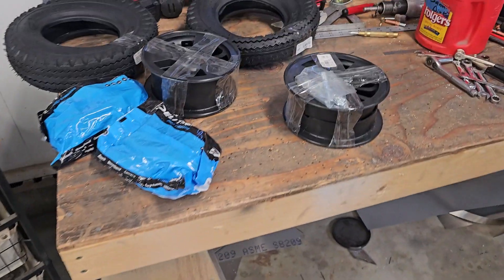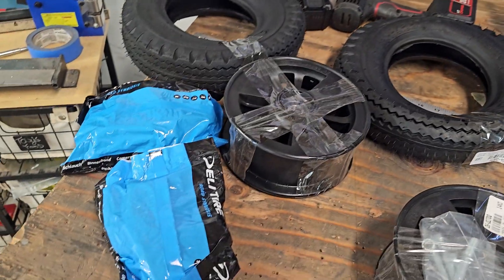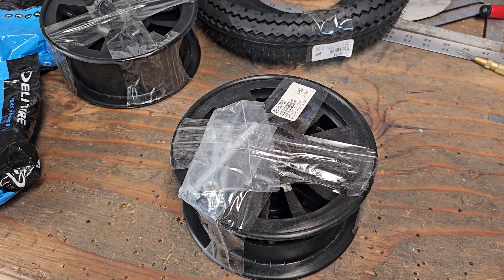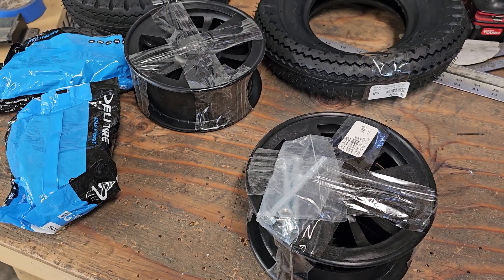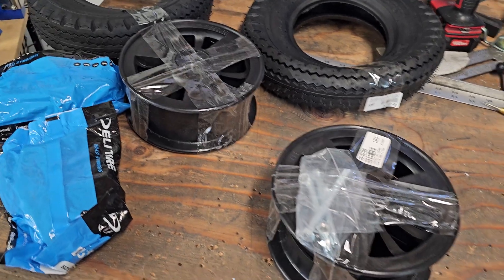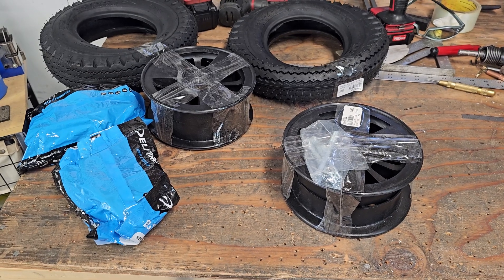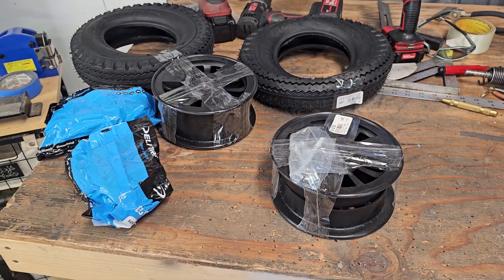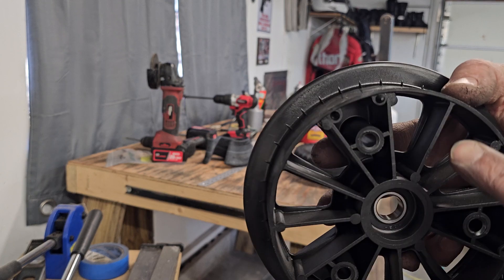Let's switch — who wants to work on tires and wheels? Got some six-inch tubes and tires. The plans called for aluminum wheels but I went with the nylon ones because I've used them in the past — they work great and they are lighter than aluminum. Since we're going for ultra lightweight, save weight wherever we can.